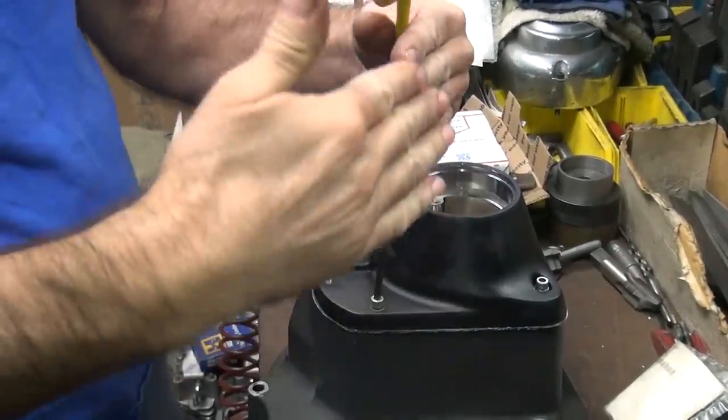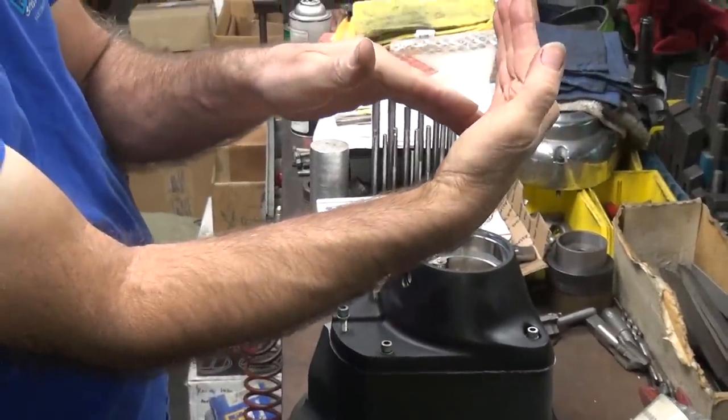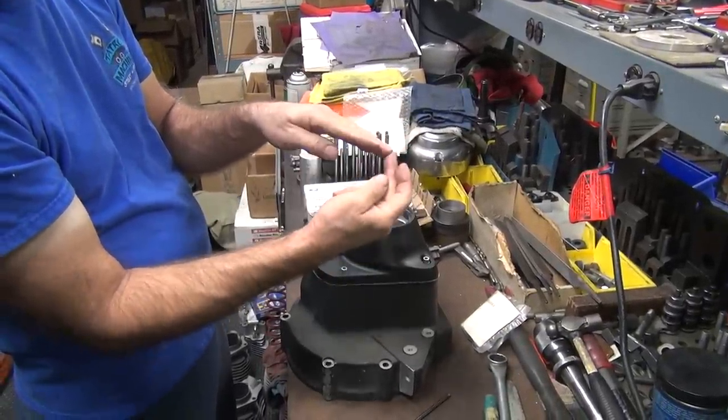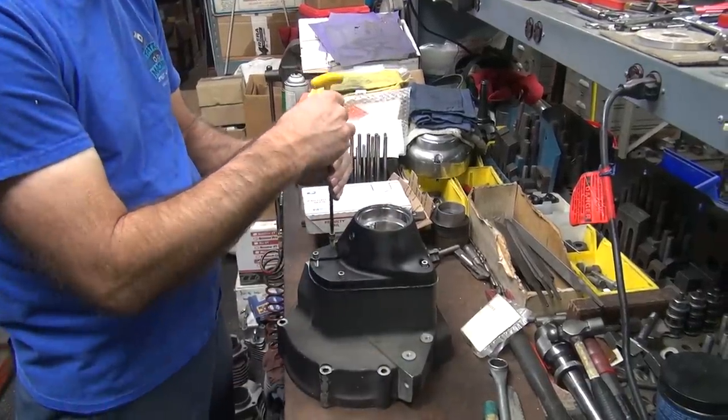Because when you've got to shove the crank down in the hole, it makes it at an angle, so it'll wear in a high spot. And we only get wear on the outside edge. Also wear on the inside edge? We're only seeing that mark on the outside, not the inside. So that's a misalignment mark.